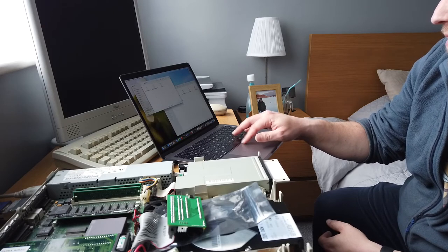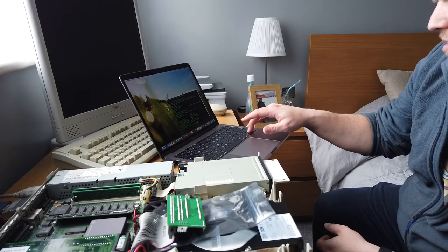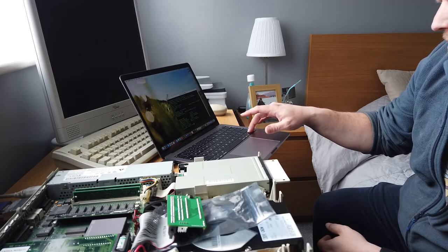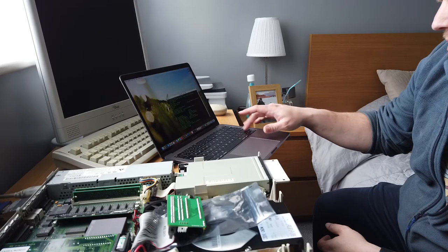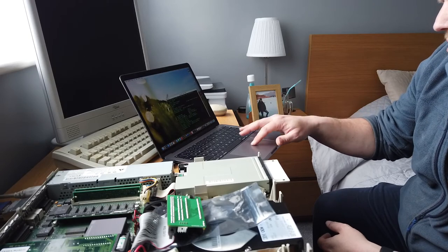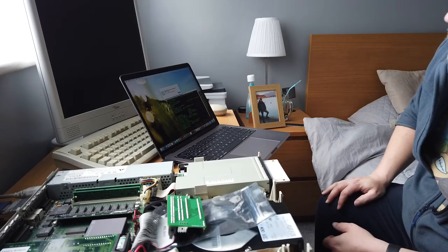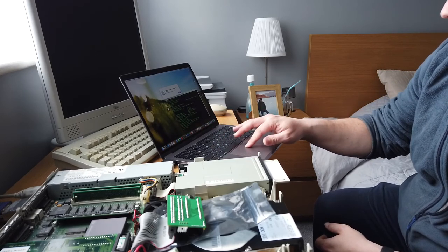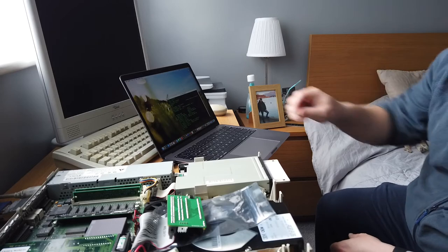Right. Moment of truth, ladies and gentlemen. Let me just get rid of these two files. What do I want to do? Volumes. BlueSCSI. Remove that file and remove that file. macOS 10, it creates these dot underscore files, which is really annoying. I don't need to delete them to get them to work with the BlueSCSI, but it's a bit easier to read the log file because you don't have the extra lines for things where it says not a disk image.